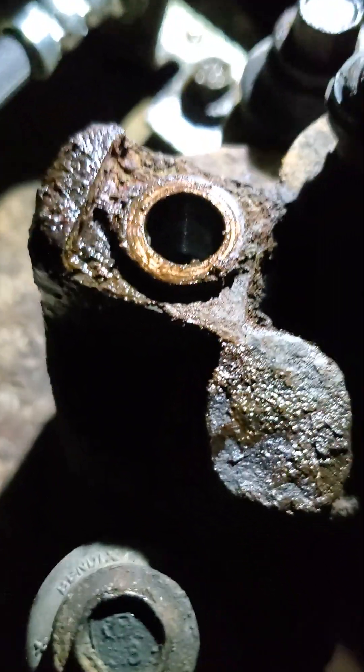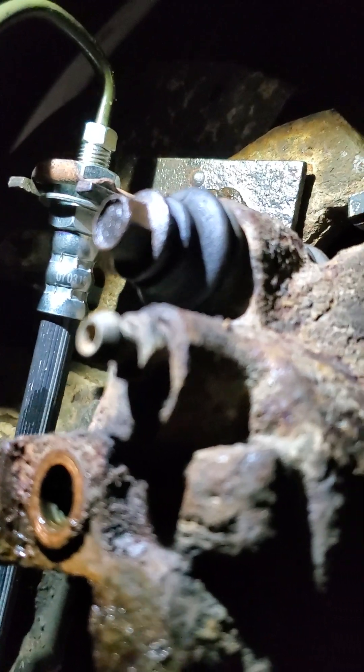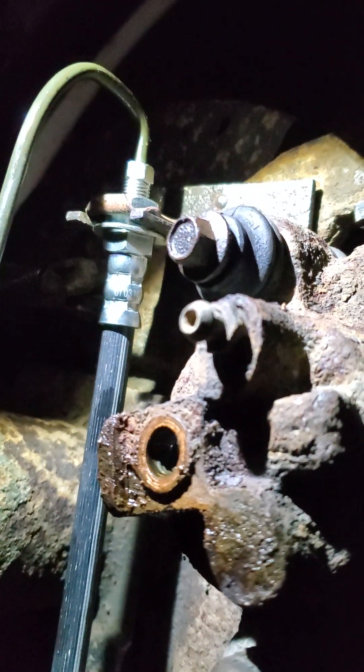It's stuck there, so I got to get out from underneath the car, grab a hammer and a screwdriver, and pop that off, then hook that up. Right here, this is the bleeder — that looks like it's pretty rusty and corroded. The best way to get that loose if it doesn't turn real easy — I sprayed it yesterday with some PB Blaster. That camera just doesn't want to focus.